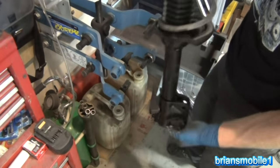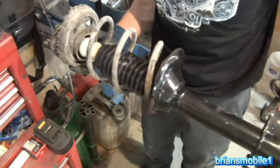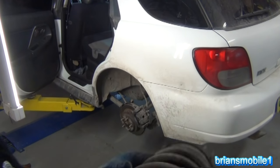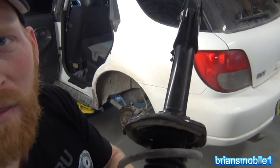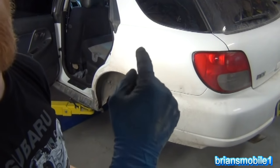That strut tamer makes that a lot easier. Ready to go back in the car — the hard part's over. Now I just need to button it back in. So when we did the top part we were really careful to make sure that that stud — the longest one that sticks out — is in alignment with the mount at the bottom. That's going to make life way easier when it comes time to putting this in the car. We'll shove this up into the top.